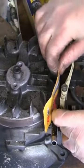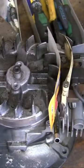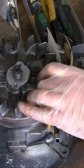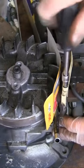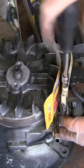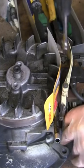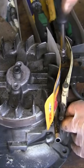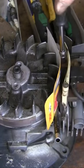So set between the two is this piece of card. I'm going to get my socket here, and then just put it against it like that, and just tighten this up slightly, nearly tight, put that in. And what you're doing is I'm pushing my thumb against here so I can push it against the flywheel. So don't tighten these right up, but get them a good way down like that,